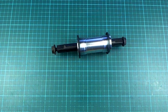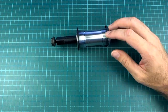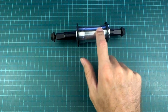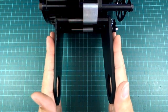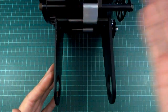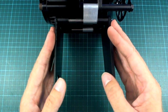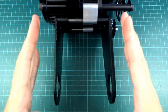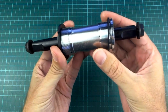Moving along with this electric bike project, I'm going to try a quick test fit of the bottom bracket, chain ring, and motor. I don't have any batteries yet - they're probably still a few weeks away - so there's not much point leaving this stuff on there. The main goal for today is to put the motor on and see how it sits up underneath the down tube of the bike, measure the distances, and figure out what kind of bracket design I might need. I'm thinking about maybe getting a bracket water jet cut. So just going to familiarize myself with these pieces and check that everything fits.